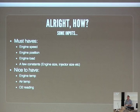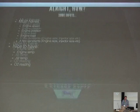What you really should have to run an engine well is engine temperature — you need to know whether it's ice cold or nicely warmed up. You need to know the air temperature of the surrounding air, as temperature affects air density which affects how much fuel you need. And an O2 reading — done by a wideband or narrowband oxygen sensor, which is fairly common on all cars these days. Widebands are an incredible piece of gear; they essentially give a reading of how much unburnt fuel is left after it's gone through the four strokes.